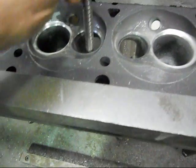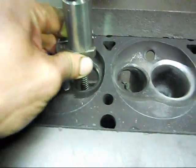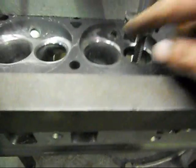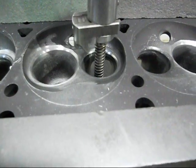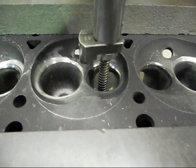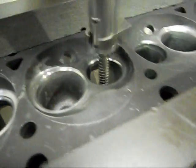I'll put this in. It's a bit hard trying to hold it in one hand and machine in the other, but we'll get away with it. We'll just turn it on and we'll slowly feed the tool down the side of the combustion chamber. We'll leave our combustion chamber beautifully relieved and nicely rounded around the edges, and we'll have beautiful flow around our valves. I'll just bring it around here so you can see.